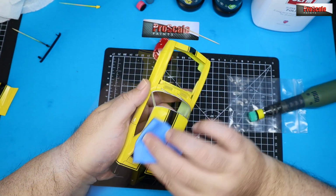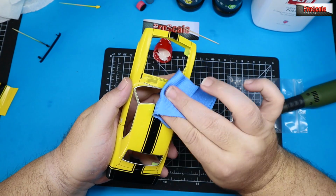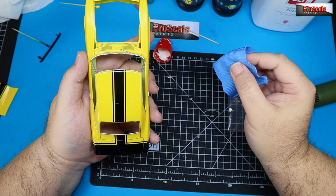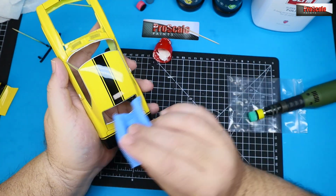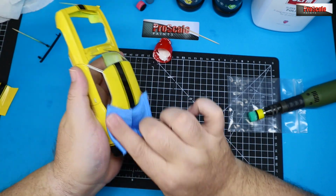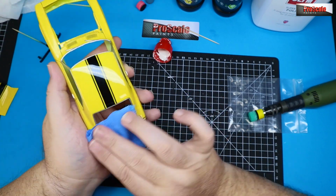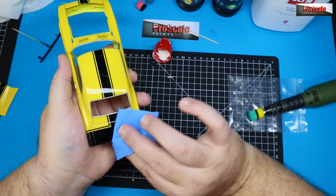But just be aware of any raised areas or any corners where the paint's going to be inherently thinner. And like I say, just watch that hard plastic on the other tool. Look at that. This is a coarse compound and a coarse sponge. So this is just going to get better and better as we work our way down through the consistencies and grit of the polishes. Look at that shine we've already got back off that one.